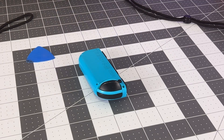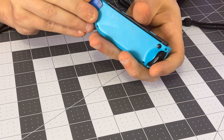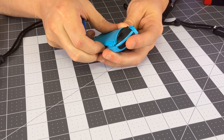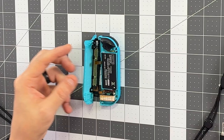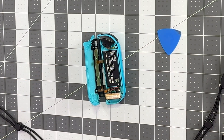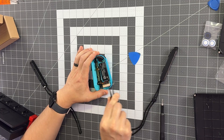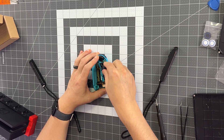It starts the same. We're going to turn over and remove four Y-shaped screws that are exactly the same size. Again, you're going to use a spudger to split apart—I find it's easiest to go from the top left on this one as well just to get it started. As before, you want to be somewhat careful because there are two ribbon cables attached and you don't want to pull them apart. We're just going to fold it open like a book. The first thing we're going to do is disconnect the battery. Just like before, avoid the two wires in the way, get down to the connector and do a pull-up maneuver—not outwards, but upwards. Then pull out the battery; it's not really glued down.